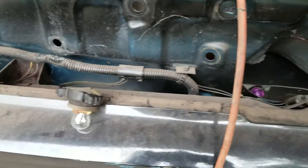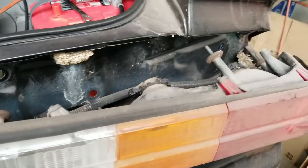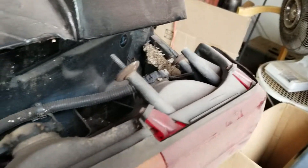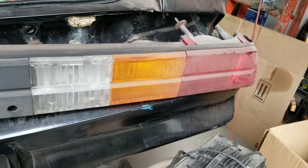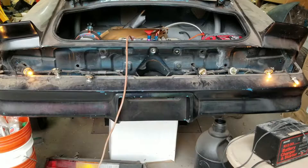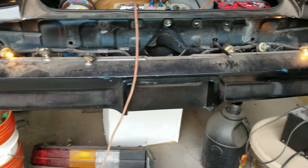Right now I'm by myself so I can't check brake lights and it's too light out. All I've got to do really is drop the garage door. But if I don't have brake lights, it might be the fuse panel — that's the next place I'm going to check. So right now I'm just popping taillights, getting bulbs out, replacing. It's like Christmas time when your light bulbs work.